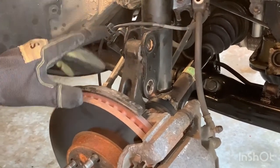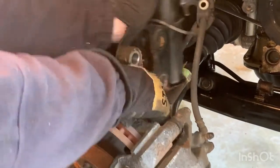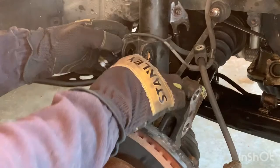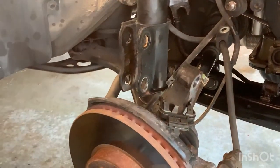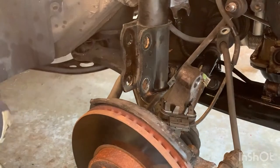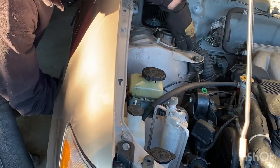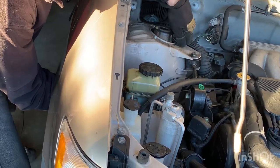Once you've cracked those loose up there, take this out here — it's hanging loose. Then take out the remaining nuts and pull the strut out from underneath. Undo your last nut while you keep the strut in place with your other hand.